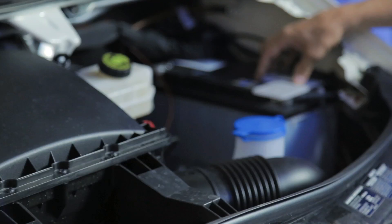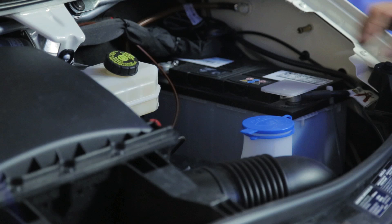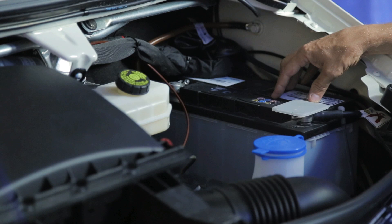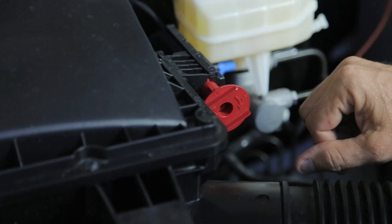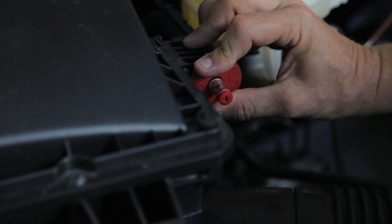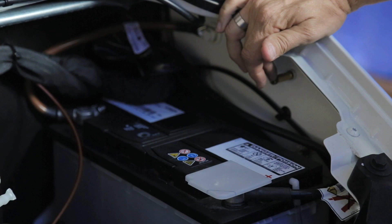Underneath your hood you'll find your auxiliary battery. The engine starting battery is located below the driver floorboard in the passenger cab area. The auxiliary battery under the hood is a 95 amp hour battery, which controls and powers the interior of your coach. For boosting your engine starting battery, Mercedes-Benz has left a port underneath the hood. Hook your positive cable onto the red area and your negative cable onto the brass ground post just above the auxiliary battery.